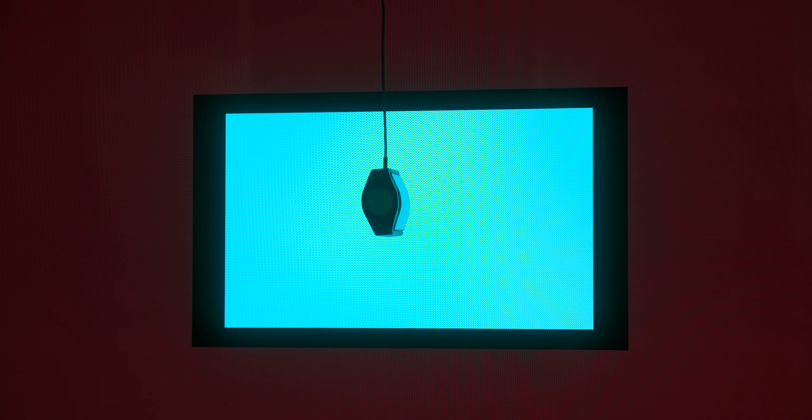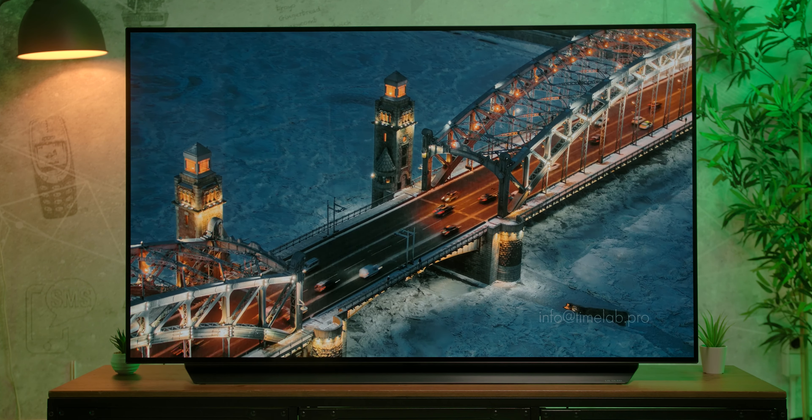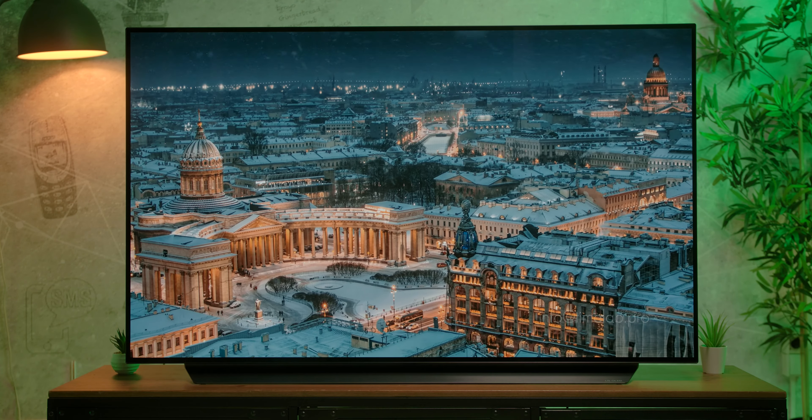Overall impression is stunning even if we did have high expectations. However, it's not all roses, since we did notice something weird during our color tests — a rectangle in the middle of the screen which changed colors during the test remained faintly visible even when the test was done and the screen should have been dark. There was a light image retention which fades after about 10 seconds, which we would not attribute to OLED burn-in but rather to a badly set panel parameter, probably fixable via a software update. Previous LG OLED models showed that OLED burning is rarely a problem for home users even after longer periods of use, and the CX has various features implemented to prevent the problem.